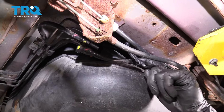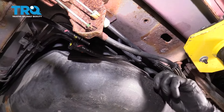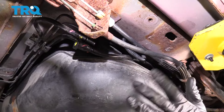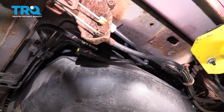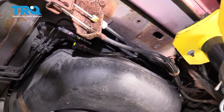Looking along the driver's side of the fuel tank, you can see wiring leading to the top of the fuel tank. We're going to take care of that. Once we bring the fuel tank down, pay attention to this wiring so you don't put a tug on it and potentially damage anything. Now carefully start bringing this down as slow and as safely as possible. If it seems like it's starting to fall, just get out of the way.